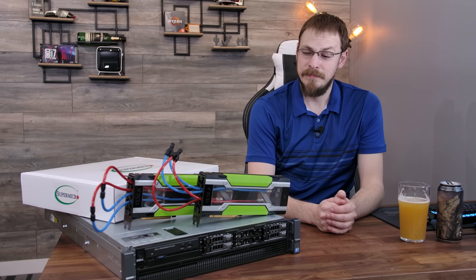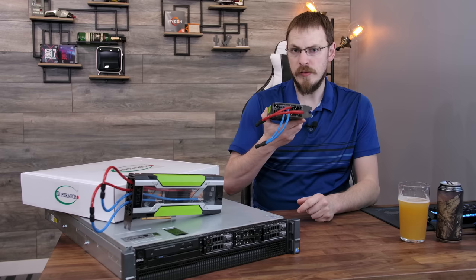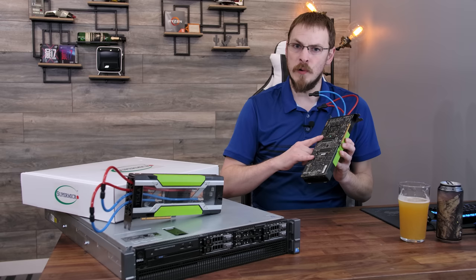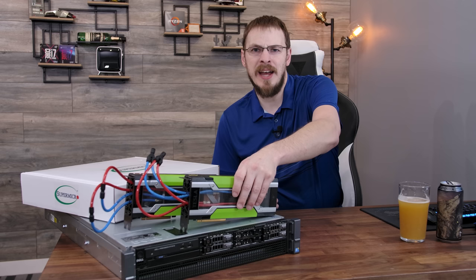For those not familiar with the Tesla M60, I'll go ahead and fill you in on the details. Much like the Grid K2 and Tesla K10 I used before, this is still a dual GPU card with no video outputs on it. However, unlike those previous cards, this is using the GM204 GPU die. That's right, this is Maxwell-based instead of Kepler, sharing the same GPU dies as the GTX 980. Also, instead of a paltry 4 GB per core, this doubles that all the way up to 8 GB per video core, or 16 GB per card.